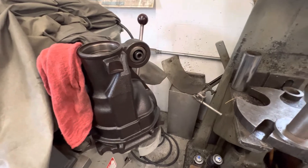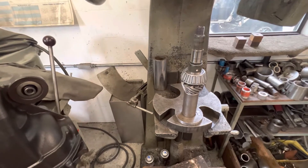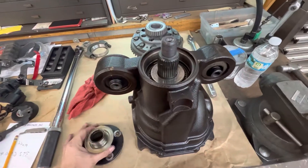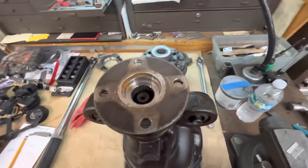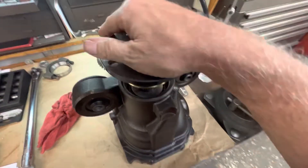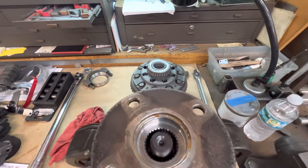Getting ready to set the pinion inside the case. We're back now — got our measurement. I pulled the sleeve out and now we're going to go ahead and put the case back on and look for a pattern setup. We're going to set this flange on and get our initial pinion torque load without a crush tube or solid sleeve in it. This is just for setup purposes. Once we have that determined, I'll go ahead and get the LSD carrier in it and we'll get our first setup.